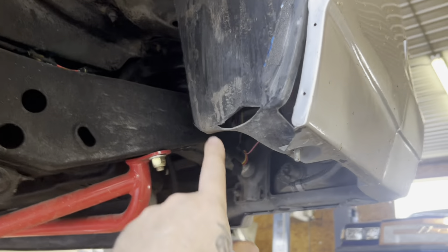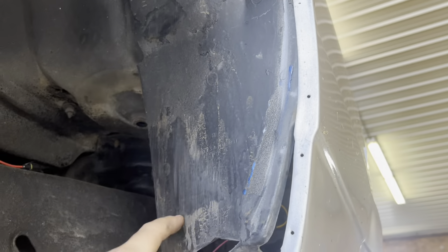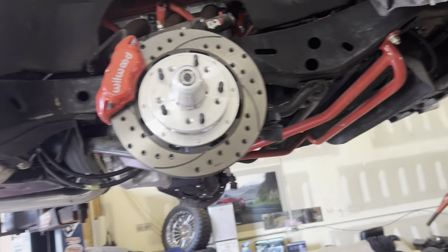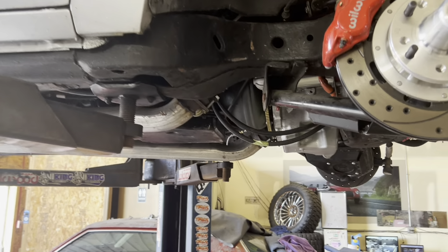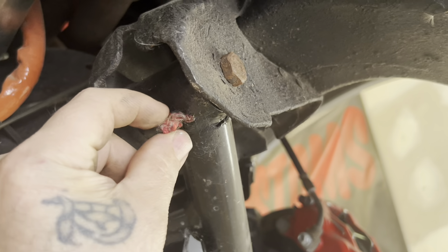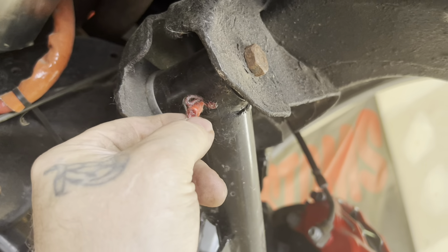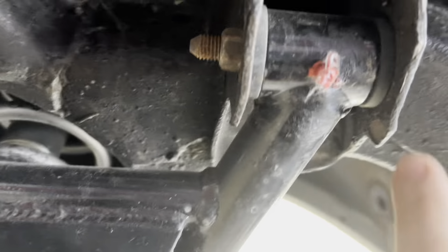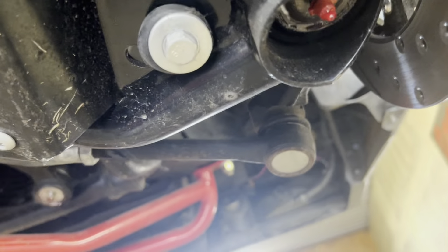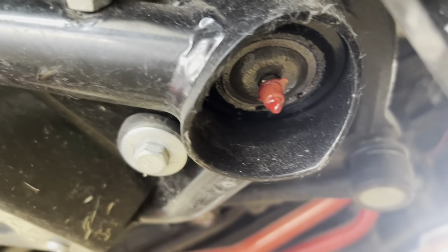This front piece, you can see it's already rolled — you gotta lose that. This Zerk fitting got some red grease on it, but I don't see any red grease over here on this one — it definitely doesn't have any grease. No grease on it at all. Ball joint — yeah, it's got some grease on there on the boot.